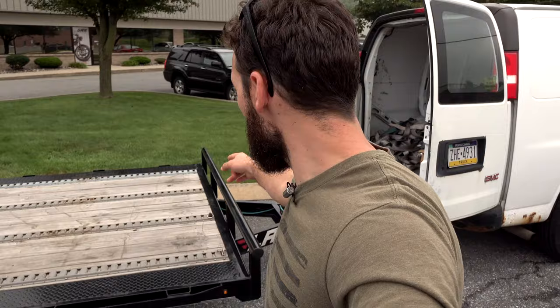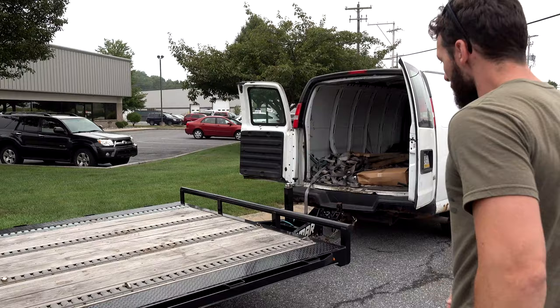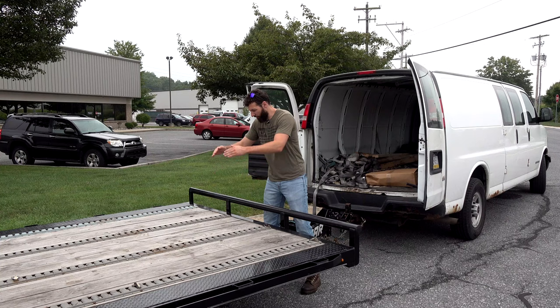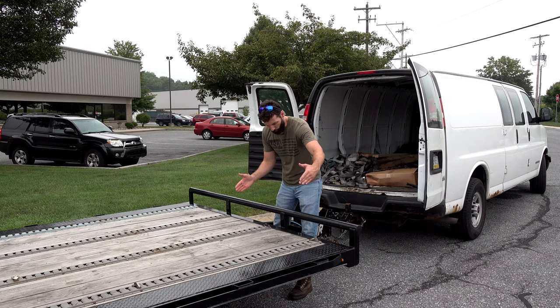Now you probably don't have, or maybe you do, maybe you have a trailer with E-Track — E-Track is this stuff and you put little D-rings in there. I prefer that because I put a lot of bikes in here. But if you don't have that, that's fine. Most trailers are going to have a hook here and a hook here in the corner, and if you don't have a hook, you can just wrap it around the bed rails. As long as they're evenly distributed and you're putting one bike in the middle, you're going to be fine. If you are putting multiple bikes in, you do need multiple hook points to tie down your straps.